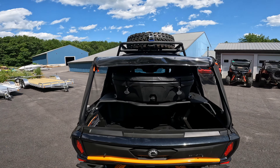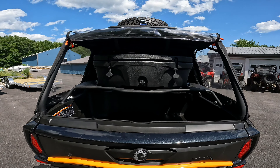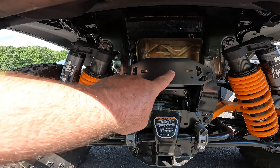Once we get inside, you're going to notice that we added a rear view camera. Typically if you've seen our videos in the past, I put them up on the back window or in the roof — but as you can see, there is no section to put it in. So we got pretty creative and decided to put it right here underneath the tailgate handle. It is a little bit of work to do, but it's protected right there. Most of the time the instructions tell you to put them down here right up in the back, and that does work well especially if you're going to be using this thing to hook up to hitches. But keep in mind down there there is going to be a lot of potential for debris, exhaust, and especially in wintertime, condensation. So we wanted that camera up here, nice and protected. I like how it came out — nice clean look.